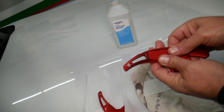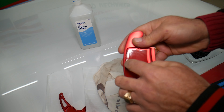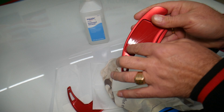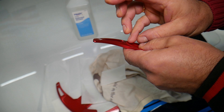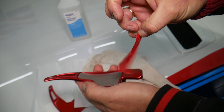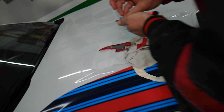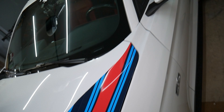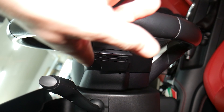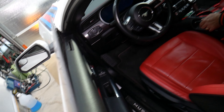Look at that — beautiful cover, it's aluminum, really well designed, not plastic. It feels great, high quality — nothing cheap. Now we're going to peel the protective trim from the tape. You need to get that isopropyl pharmacy alcohol and clean your shifting pads on the back side with the alcohol as well, to make sure they're not greasy. Don't touch them with your fingers because often people apply plastic shine UV protectant, which will prevent the double-sided tape from sticking correctly.